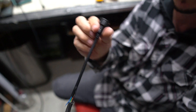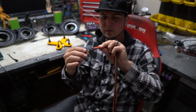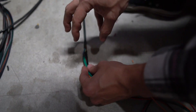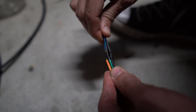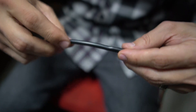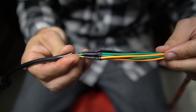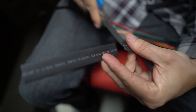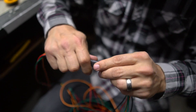You'll notice there's a fifth wire because these are five-pin connectors — I don't need that wire so I'm just going to clip it. Let's hit these guys with heat so they get that nice seal all the way around from the internal glue inside the heat shrink. It's actually nicer to do it on the ground because the heat concentrates, bounces off the ground, and gives 360-degree coverage. We're going to add even more heat shrink over the top on the next step. Now I want to add a piece of heat shrink that goes up right over here, then we'll slide it back over after we have the wire loom in place. I'm going to start with the long side, add the other shorter wires, and take this all the way down to the end.